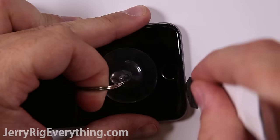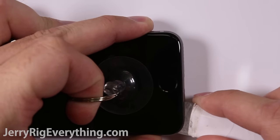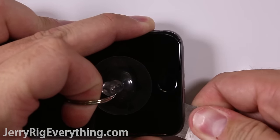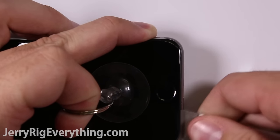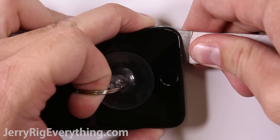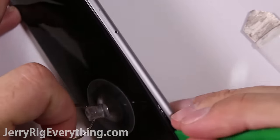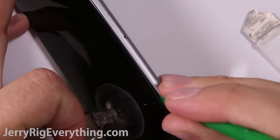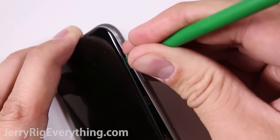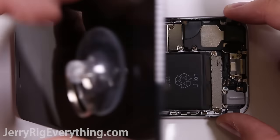To get at the battery, you do have to open up the phone. Go ahead and take your Pentalobe screwdriver and remove the bottom two screws. Then you can lift up on the screen with a suction cup and slide a tool between the metal frame of the screen and the metal frame of the phone and pry up very gently. There is adhesive surrounding the screen and the frame, so slide your plastic pry tool between the two to separate them, which makes it easier to lift off the screen from the frame.